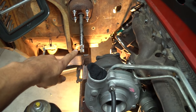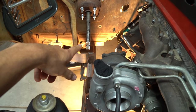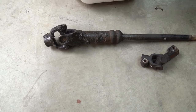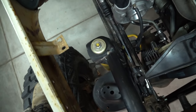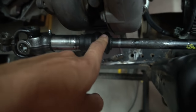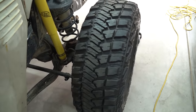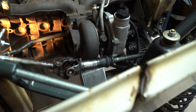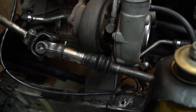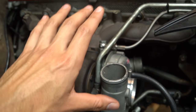Here's my steering column — I don't actually know everything that's been done to it as it was part of the deal with Lawrence. I know it's been shortened and the spline has been recut. Here's my 80 series box, and I'm not 100% sure what this uni-joint is — I think it's off a KUN 26R Hilux but I can't confirm that. First time I've had the steering system in the car. There's about 10mm between the turbo and the steering column on both the hot side and cold side. I got the wheel on and the wheels turn! I'm not going to do anything about the clearance issue for now — if anyone has good ideas let me know in the comments. I really want to avoid high mounting this turbo and I want to keep the engine as stock as possible, like it was in a Falcon.